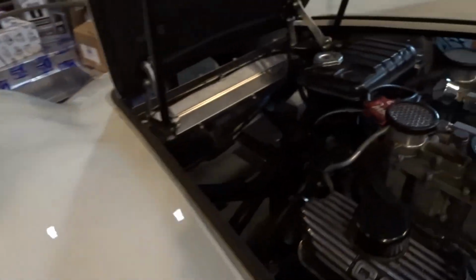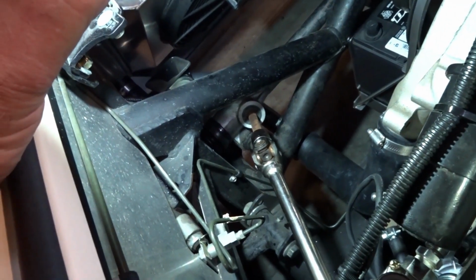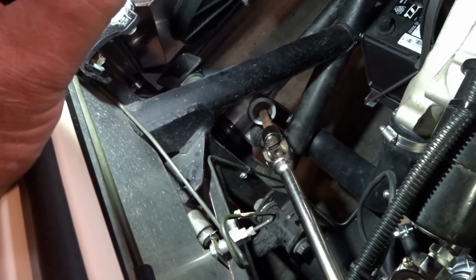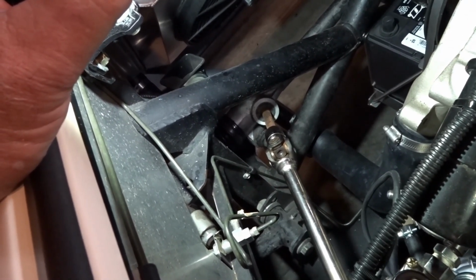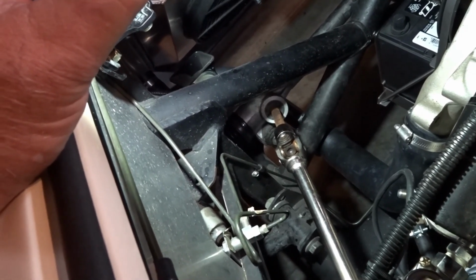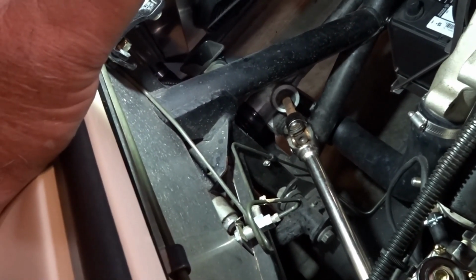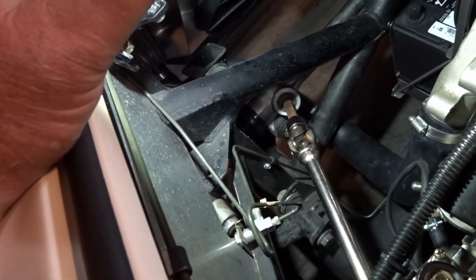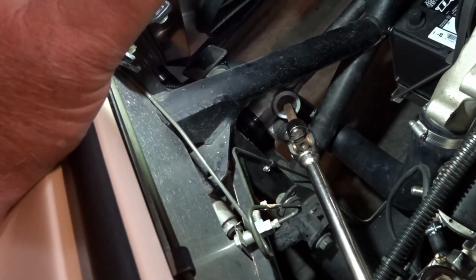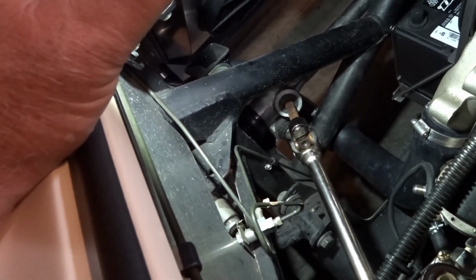So all of the front steering shaft is put together. All of the set screws on that are thread locked, so they're not going to come off. We did add a stop nut to the main set screw, so that's got a stop nut now. And we lubricated all of these U-joints. So I went ahead and pressed out the bearing caps on each side of those and added some grease and then put them all back together, because I figured this thing's probably going to be on here for a good long time before anybody gives it attention again.